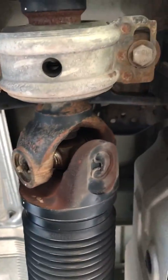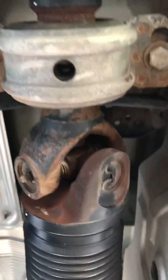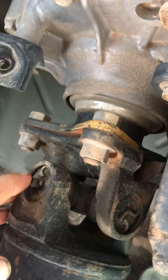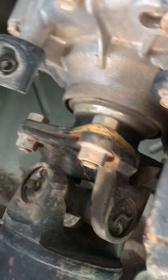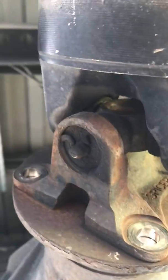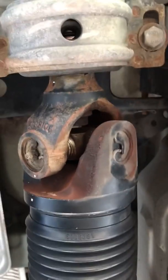He's got about a hundred thousand miles on this truck. Looking at all these u-joints, I noticed these little grease fittings are pretty dry. Normally these need to be lubed about every 15 to 30,000 miles — if you're really proactive, every oil change. They do not appear to have been greased recently, and he brought his truck to me today because he has a vibration in the driveline and a clunk.